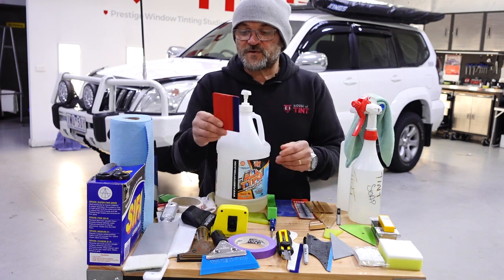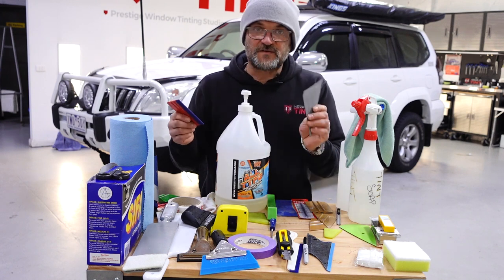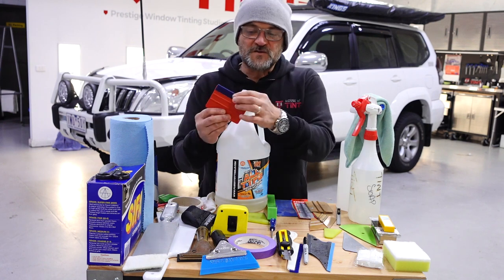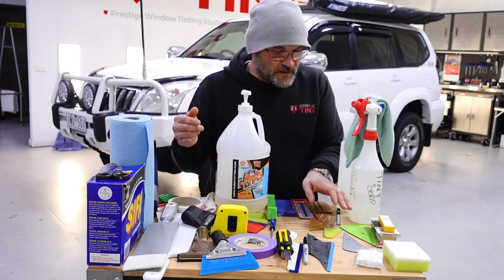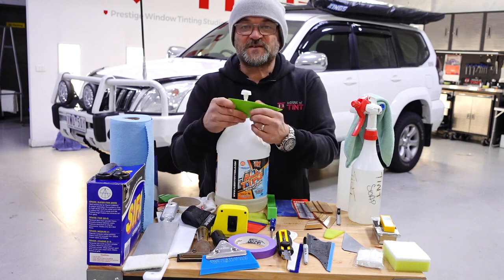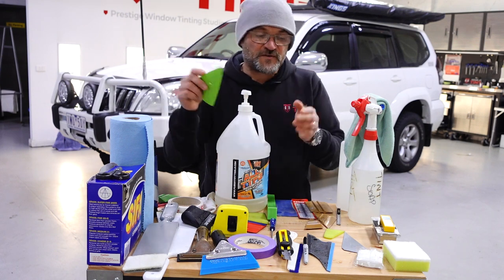For heat shrinking, use a shrinking card. I see a lot of guys using something as hard as the Platinum Easy Reach — don't push the film down when heat shrinking with anything hard because you're likely to crease it. Always use a soft card. There is also a thing called a Mac Tac — it's quite thick and a lot of installers love using it, but I prefer something softer. For squeezing down the side channels with door glasses, I love using this contour card. This particular one is the green one, so it's quite soft — touch wood, I haven't scratched anything with it yet. It's quite thin and will reach right into the side channels to squeeze out the water.